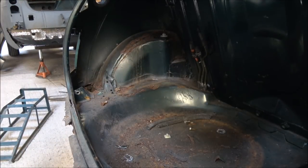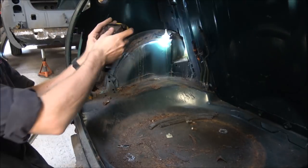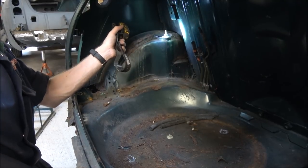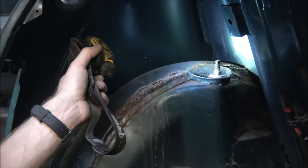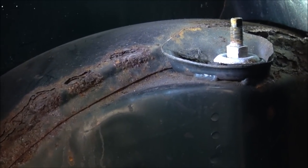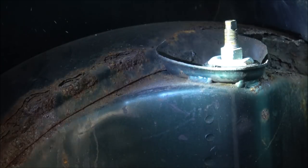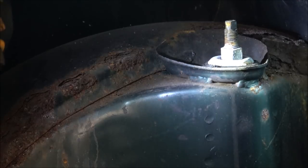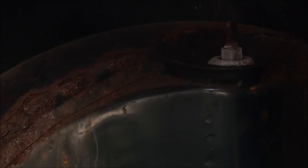And once I get some light in here, I'll be able to see that it's located over here. So what we have here, if I try and zoom in as best I can for you, up, a little bit more zoom. Trying to do things one-handed is quite difficult. All right, so hopefully you can see there that we've got a nut here, and obviously we've got a bit of thread, and then on the top here we've got a plain section, but it's actually got two flats on each side, so you can grip it with a spanner to get it to the right setting. But it also comes in useful for when we're undoing it, because it means we can hold against something whilst we undo the nuts. So let's just see if we can find a spanner or two that are going to fit.